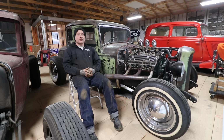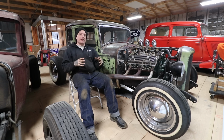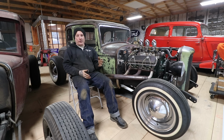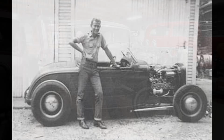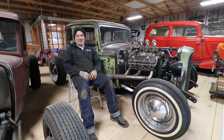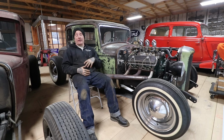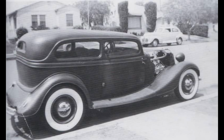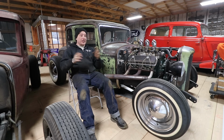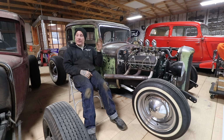For the dog dish or poverty hubcaps, you have much like what is on the Schroll coupe here. That started early on, I think, with the 40 Ford wheels. They came with a little hubcap that goes in the center, and people a lot of times call them dog dish hubcaps. Moon, my dog, uses old hubcaps for a dog dish, so I'm sure that's where it came from. Those hubcaps can be interchanged. The nice thing, and we've covered in the wheel discussion, is that the 40 to 48 Ford and even pickup truck wheels and later all use the same dog dish hubcap, so you can interchange them and change the look of the vehicle. You can put numerous types of 40 Ford, 41 Ford, and so on and so forth.